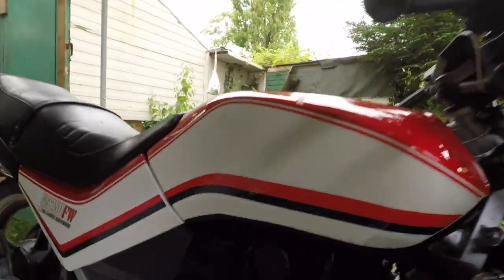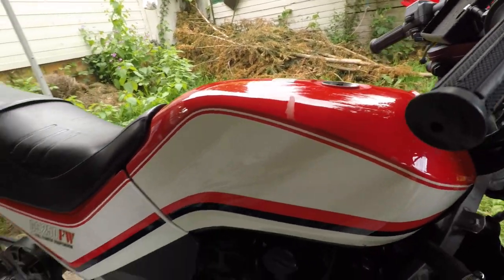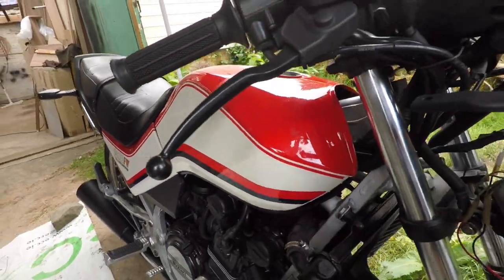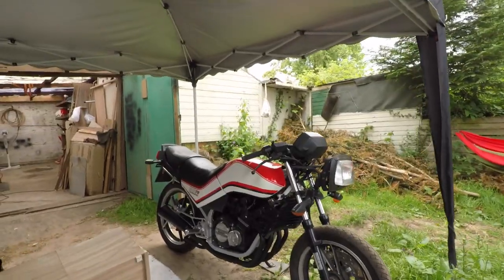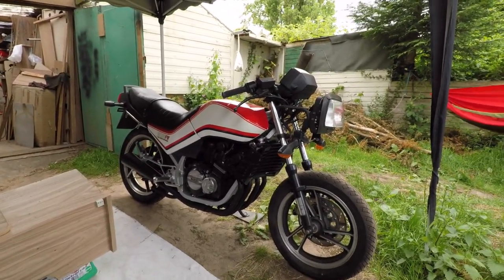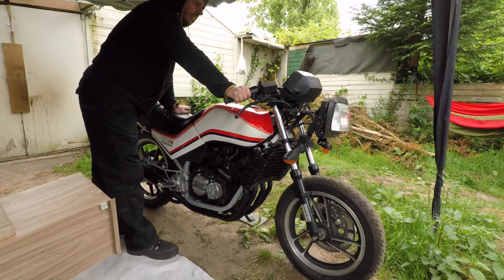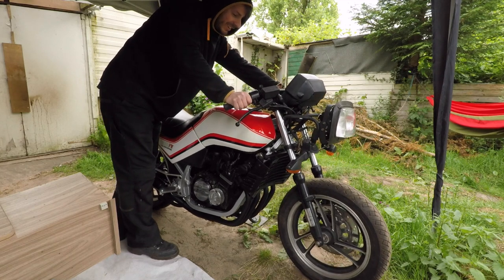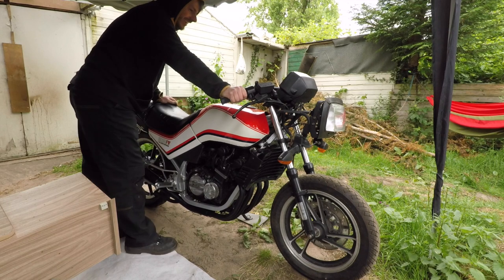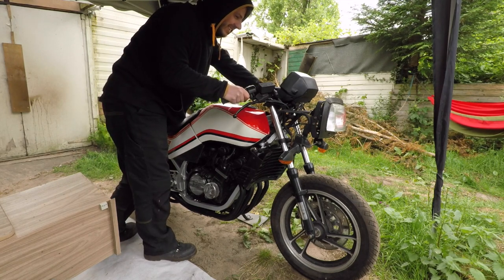Here's the moment of truth. I've put the tank on - I painted this black. The tank should be repainted because that's not ideal, but look at the polish on this tank - thank you Maris. Alright, some gas in it. I gave it a couple of starts before with no spark plugs to build oil pressure.